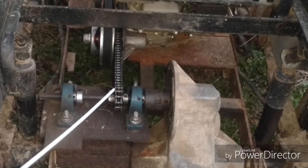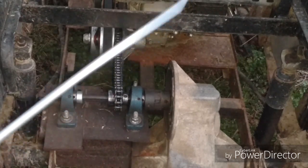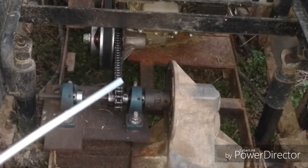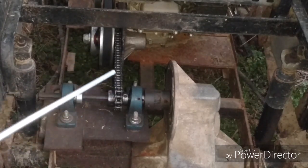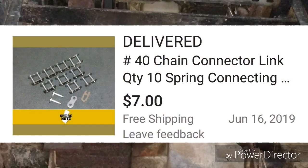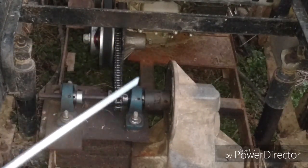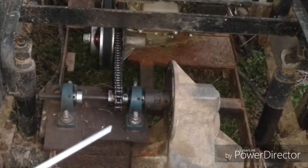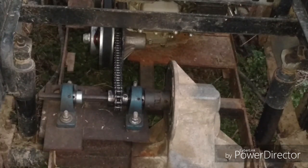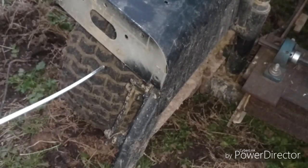I went over the first sprocket I bought — this is the second setup, which slowed it down just a little but gave it more power. The first chain I put on, I put the master link keeper on backwards and it nicked the torque converter and knocked it off. When I put the second one on the right way, I've had no more problems. I did order a pack of master links for seven dollars. I ordered tires twice — these are just regular rear tires like would go on a lawnmower, but they really do an excellent job. Two of them are about sixty to sixty-two dollars.